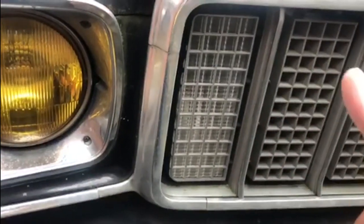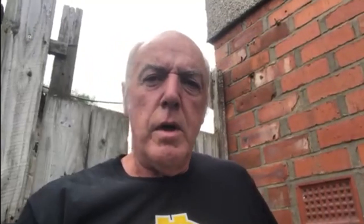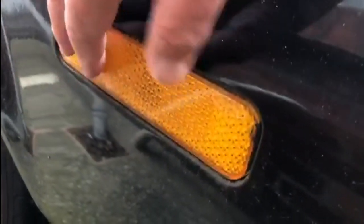It's not a problem with the bulb on this side, which leads to a couple of other possibilities — it could be a bad earth, a bad connection, or a broken wire. Or it could be the bulb in the side marker on the passenger side of the vehicle. So what I'm going to do first is check the bulb in there before I go into the wiring, because it's always worthwhile checking the cheap or free stuff first.